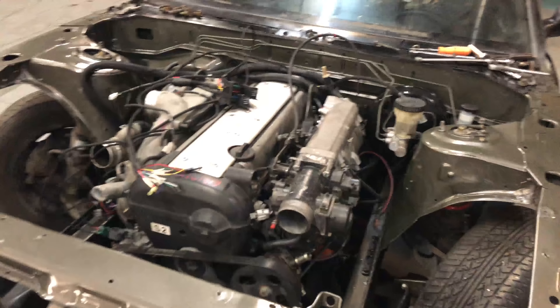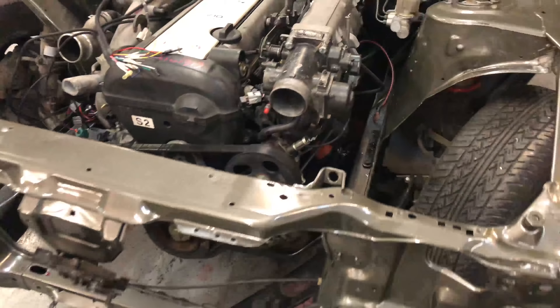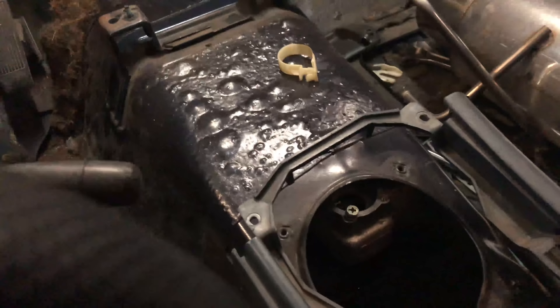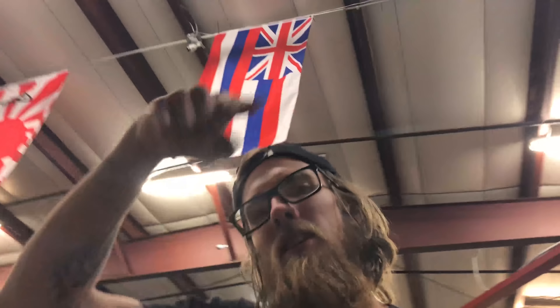So we dropped the engine in there. It's gonna be scooted back as far back as we can — you can kind of see down there. Scooting it back will close up that gap a little bit, give us more room on the radiator, and make the shifter line up a little better. It's not bolted up right now which is why it's off to the side, but there she is. Thanks for watching — like, comment, subscribe, let me know how you like the new phone. Video should be sauce.